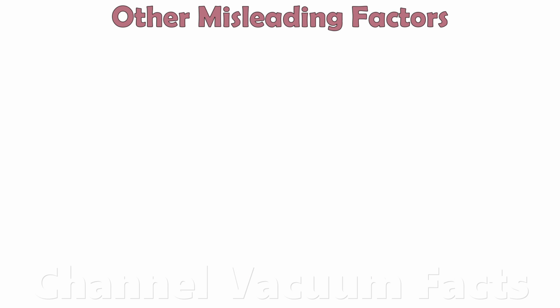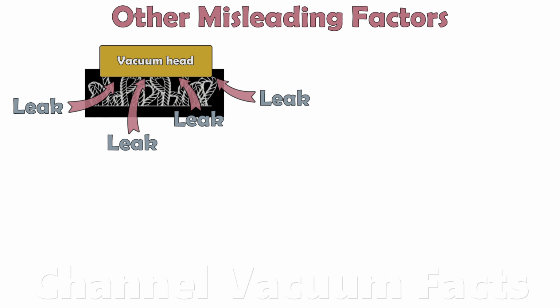There are other differences between shaggy rugs and fitted carpets that mislead in amateur testing and artificially inflate the apparent performance of high airflow machines. The long floppy tassels on a shaggy rug make it relatively harder for any cleaner head to make a good suction seal. On high suction machines, that seal is required to draw optimum airflow through the deeper pile. As mentioned earlier, more air travels through the upper pile regions because there's less pile resistance, so air gaps will be where most airflow enters, generally bypassing the carpet. Brute airflow machines still pull large airflows through the lower pile, even with gaps on shaggy rugs, and so can get away with sloppy cleaner head design, but only on porous shaggy rugs. This is why rugs are favoured in misleading bedroom tests and con people into thinking such machines are better.